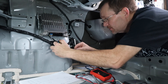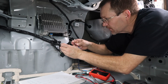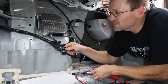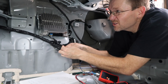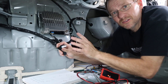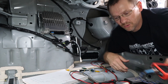Next we grab the 16-pin plug — this also looks like a speaker plug. We take our tone generator and identify the rear door, then confirm it's the driver's door and tweeter. How this harness is broken apart: the top row is the driver's side and the bottom row is the passenger side. As we said, you don't need all these tools — a digital multimeter and a 9-volt will do.